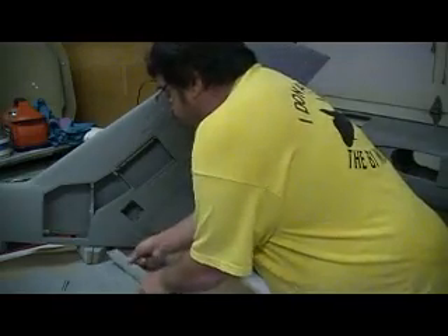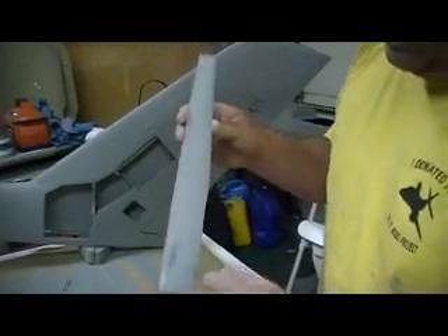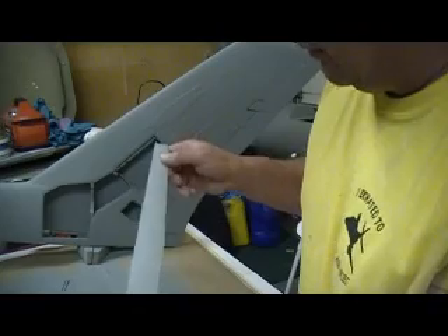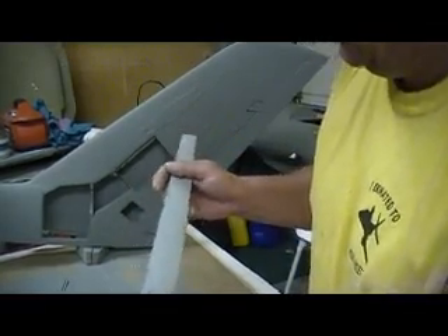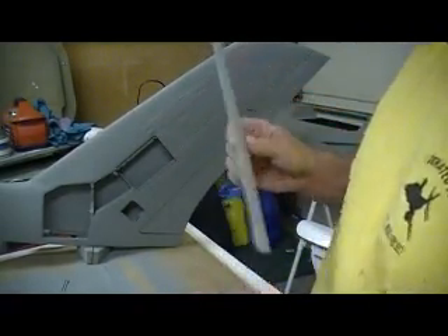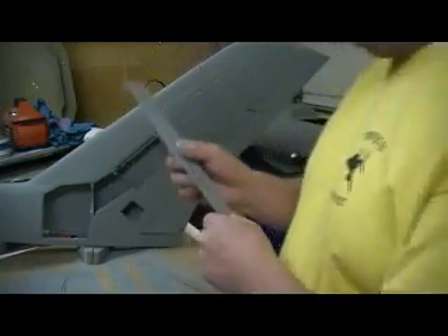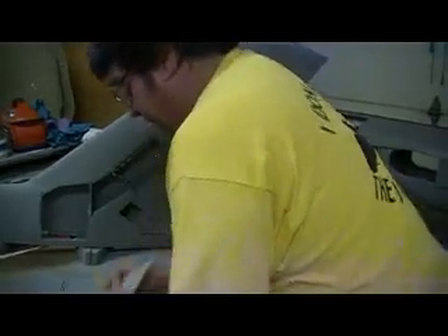Got all these done. My front gear doors - see, it's fat here and skinny here, and it hinges on this side. So I'm gonna have to make one hinge longer than the other - the same size hinges won't work. I'm gonna show you how to do that, quick and easy. That part's looking pretty good. These here I gotta prime the other side.